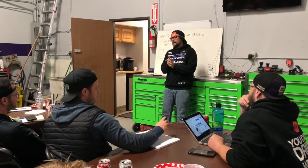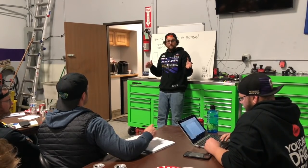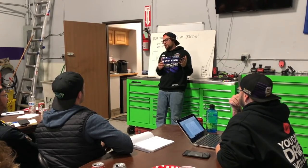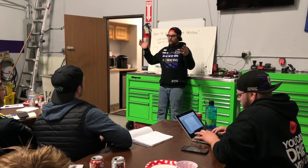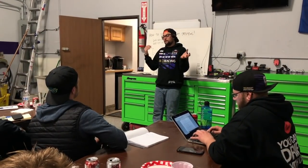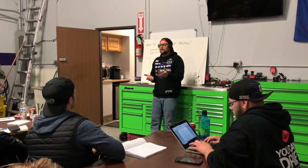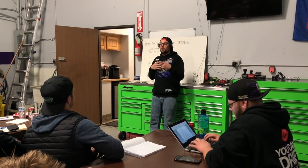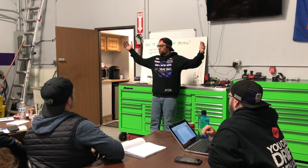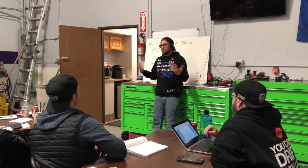Anyways, obviously it's not ideal to have a ton of scrub. If you're running lower than like a 0 offset wheel in the front, you're being affected by that. Now, if you have 70 degrees of steering angle and you slip a 5 or 10 mil spacer on to get the clearance so you're not rubbing the tire on shit, for sure, that's what you're gonna do. But on my car, I run steering limiters on my SLR kit because I don't have enough room to run super wide offset wheels. So I limit the last 5 degrees by just slipping on a limiter.